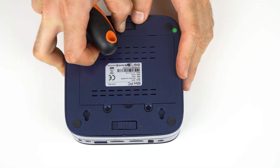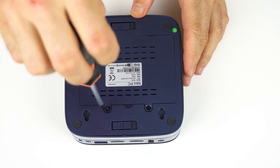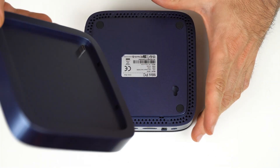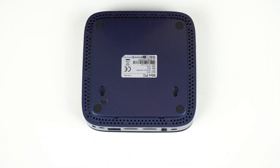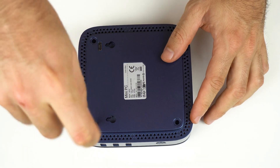Disassembling the MP60 is easy, which is really nice for a change. The two locks allow you to take off the bottom section if you're not using it for a 2.5 inch SATA SSD, so you can make your mini PC even smaller — kinda cool idea actually. Let's remove the two screws to find the 2.5 inch SATA slot. Now we can pull off the bottom section since it's unlocked, and it connects via USB-C, which is interesting. But to get inside, there are still a few screws — and of course they're under the rubber feet. Rip those off, get the four screws out, and Bob's your uncle.